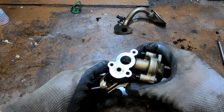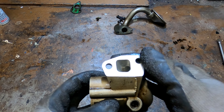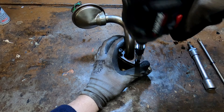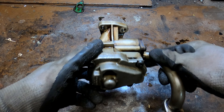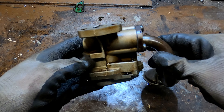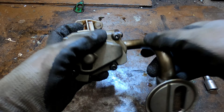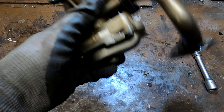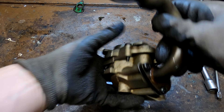The gasket must be replaced, and the part that connects to the engine block was factory installed without a gasket, so we'll assemble it the same way — without a gasket. The oil pump is assembled, but as you noticed I cleaned it before assembly. Now we want to put some oil inside it, and the best way is to feed some engine oil in and spin it with the crankshaft.